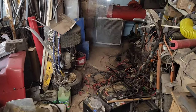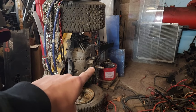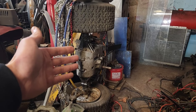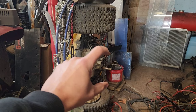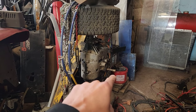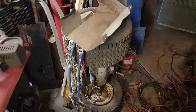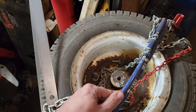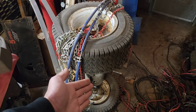Here is our spare — we've been saving it for a while. This came out of a rear CVT pulley Toro setup. They were really popular in Europe, and they tried to sell some Toros like that here in the United States but they just did not take off. It had a CVT style giant clutch pulley that was huge and stuck out, which is why this has a really weird extended shaft with two separate clips. We're going to rip this apart and see if we can pull the parts we need out of it. The other problem is this has encapsulated D-hubs in it which are rusted entirely solid and will not come loose, so the tires and axles are screwed.